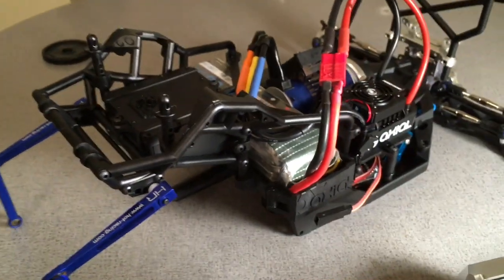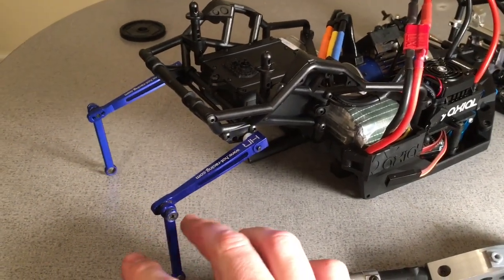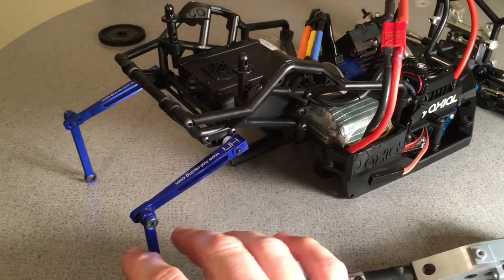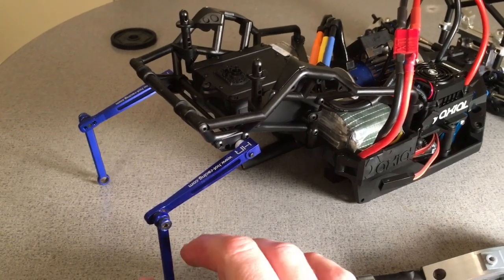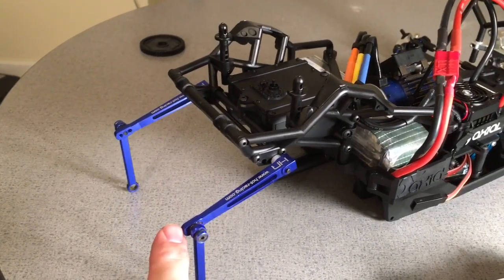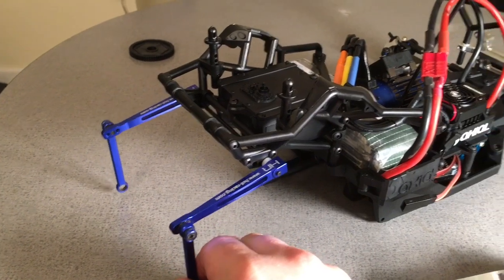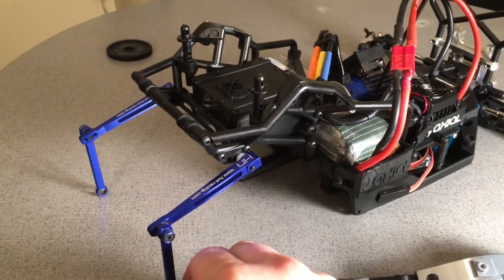If you follow my channel, you may remember this Hot Racing rear sway bar. I had it on the Rock Racer Yeti kit that I had, and I had a problem with it. It was actually hitting the cage. When I say cage, I'm talking about the roll cage, the body as it sits down on there. The way the Hot Racing setup is offset, it would actually bump the cage instead of allowing the rear suspension to fully compress. So that was a no-go for me.